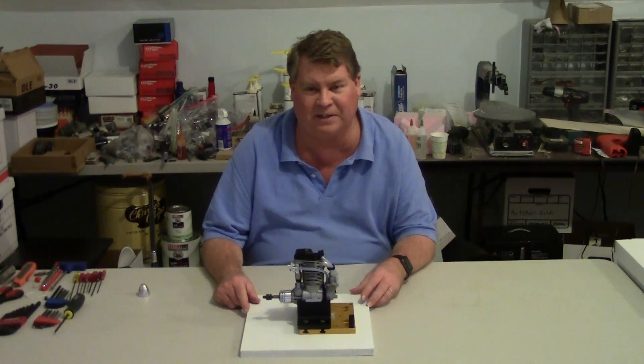I've been working with YS engines a lot lately. I had a YS-63 and a Dago Red — it was quite powerful and a fun airplane to fly. I put the engine back on the test stand recently and it ran just like it did when I was flying it a lot. Very powerful. For those not familiar with YS engines, the four-strokes are actually supercharged. This adds a level of complexity to the internals and makes them a little more expensive than some other brands, but they're also significantly more powerful.